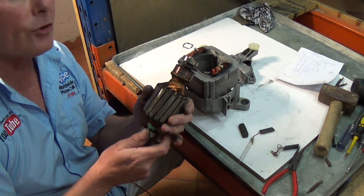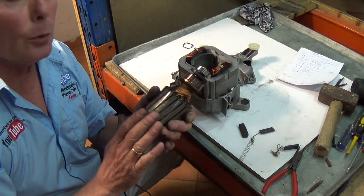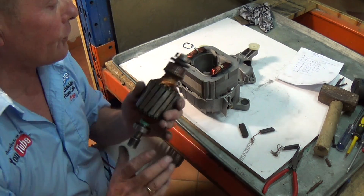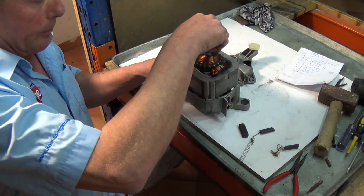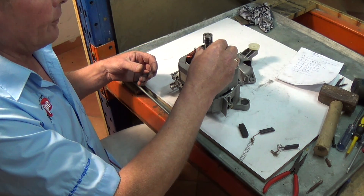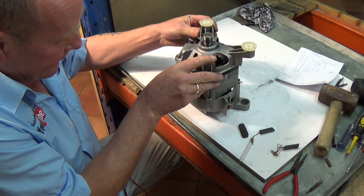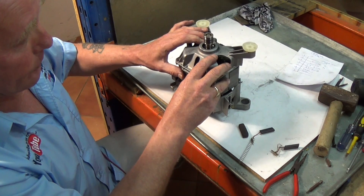Buying a brand new motor sometimes costs more than the machine itself, so where there are special deals I'll put links on the web page. This only covers Bosch, Neff and Siemens - I'll do articles on other motors at later stages. Drop the armature in - remember we haven't got the carbon brushes in yet, as you wouldn't be able to fit the armature with brushes inserted. Make sure the spring goes on and sits correctly on top. Now we're able to put the housing on - carefully make sure it goes down and locks nicely in place with a bit of spring on there.